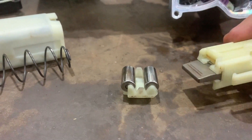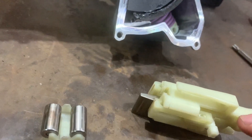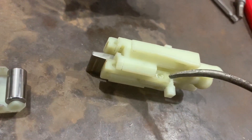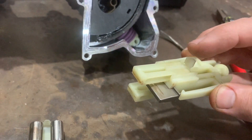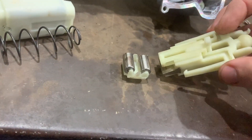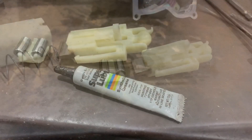I'm not understanding yet how this is some kind of self-adjuster — there's nothing on it that's ratcheting. This section here doesn't slide inside here, you can see that. It's actually pinned through here, so there's a pin through there and a pin through there. That means this whole assembly that I'm moving backwards and forwards is all one piece effectively — it's three pieces but joined together. So I'm just not sure how the self-adjusting part works yet and the discussion on setting that to its shortest limit — I'm trying to work that out.